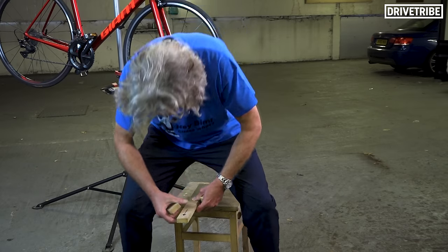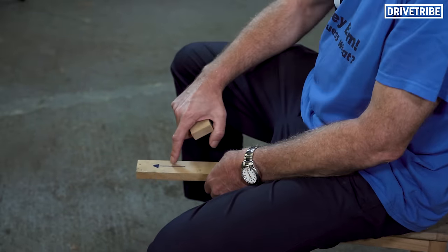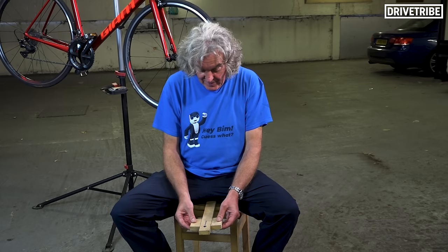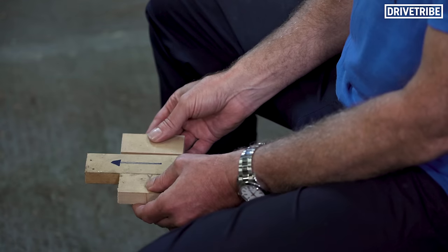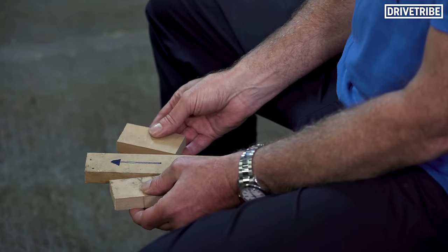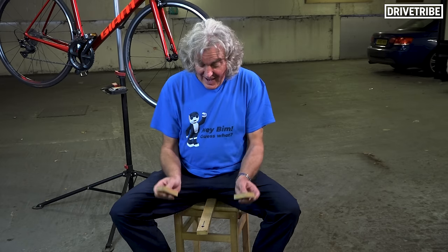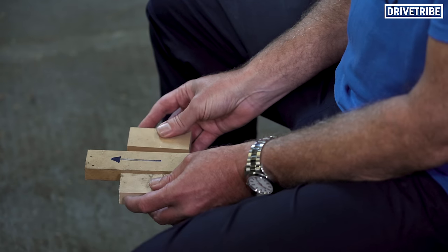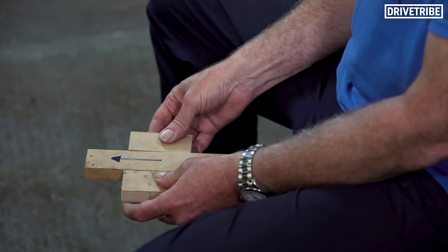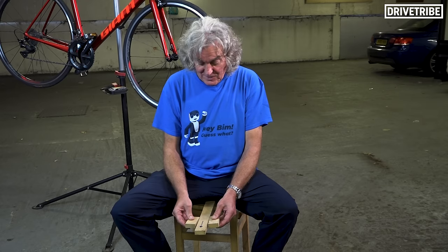Let's imagine this piece of wood is the rim of the bicycle wheel. You're looking down on it from above — it's rotating that way, hence the arrow. You might think that brake blocks should meet the rim square on; that makes perfect sense, you get all the surface of the block in contact with the rim. You definitely don't want the trailing edge coming in first, because then the rim will drag the blocks in and you will get judder and probably squeal. Even if your brake blocks do meet the rim squarely, a bit of flex in the brake mechanism will probably cause them to do that slightly anyway, and then again you will get snatch and judder.